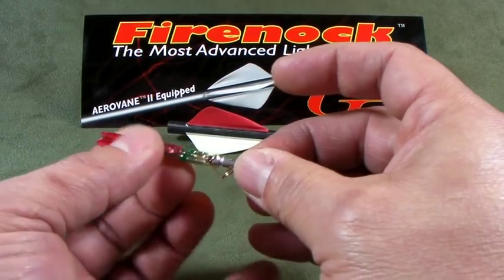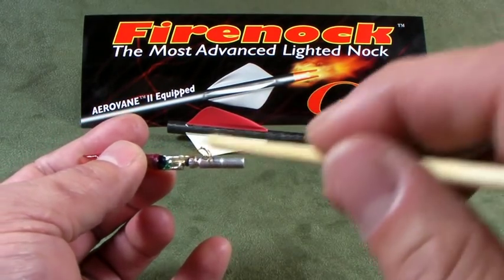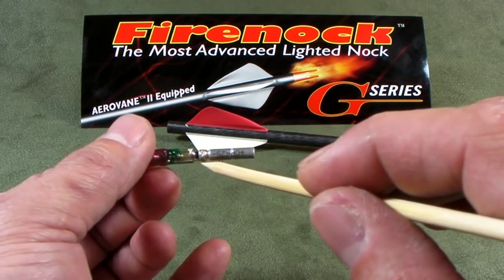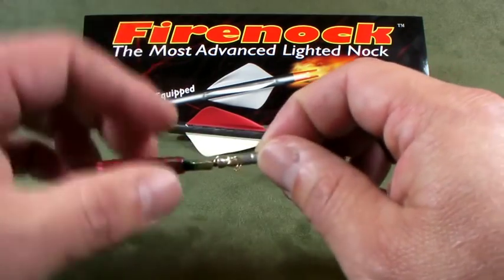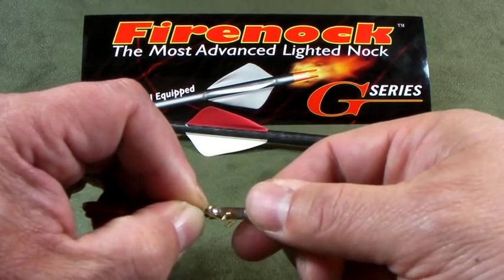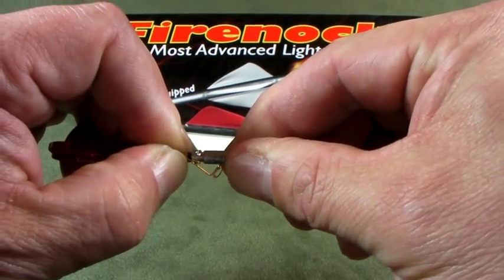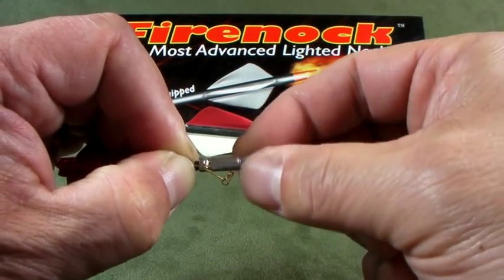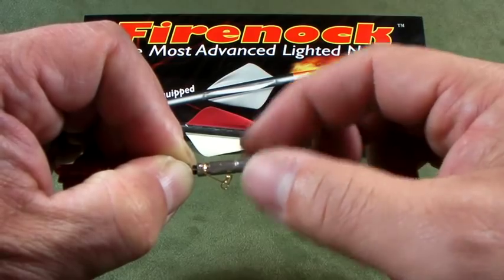It is very usual that you will see the light come on because the computer needs to reset. It is very critical — make sure the wire is behind the neck to start, and you slowly move it up to the top. Put your thumb on the wire on the circuit board, and rotate the battery counter-clockwise. The wire will slowly move up and lock itself into the battery, and you can rotate the battery with ease. If you feel tension, the wire is not correctly installed.